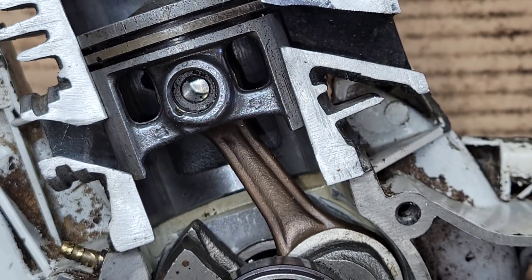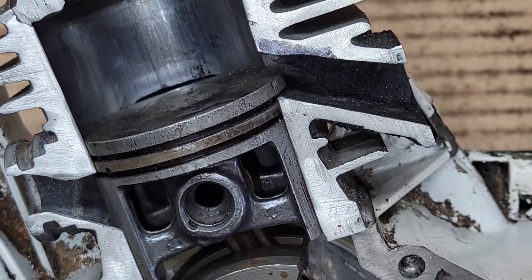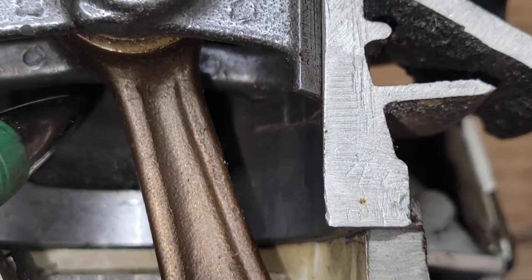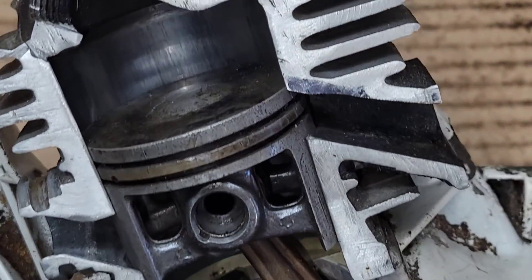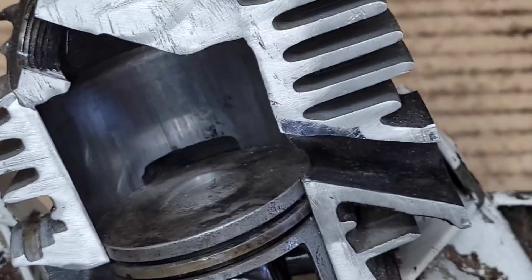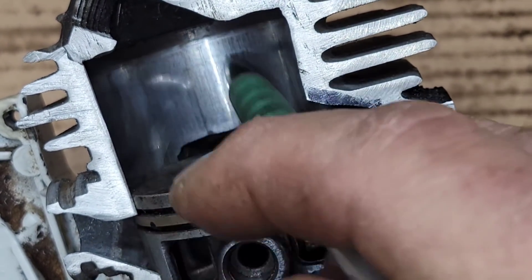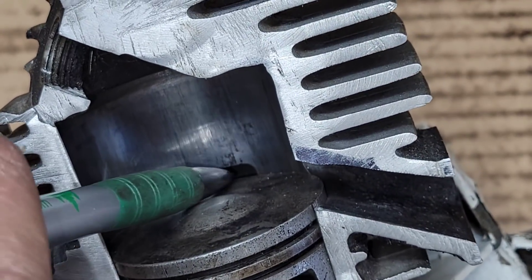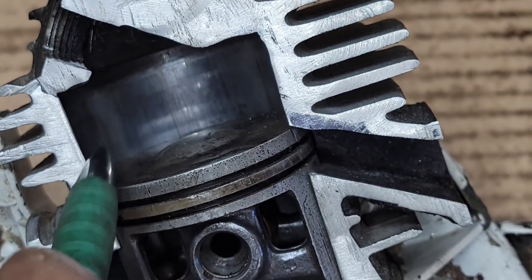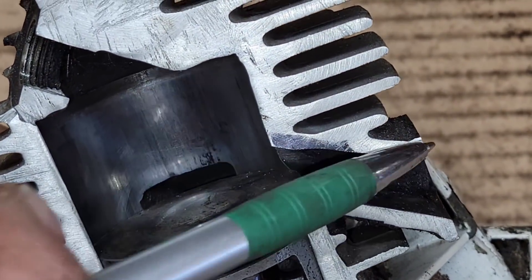What releases that charge? Your transfers. This compresses it from here to there — you get maybe five to seven PSI. When the transfers open, it lets the bottom-end charge through. There's your lower transfer and out through the upper transfer, which fills this area. And yes, the exhaust port is open at that time. The air hits this wall and swirls around, and by the time this is closing, most of it goes back — though some does get out the exhaust port, which is why you'll generally have a little fuel in your exhaust on a two-stroke.